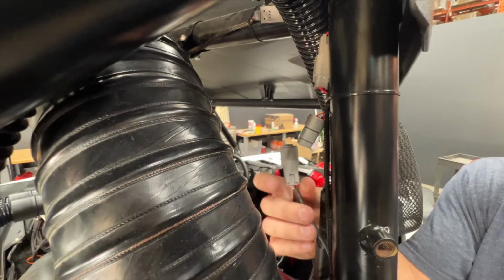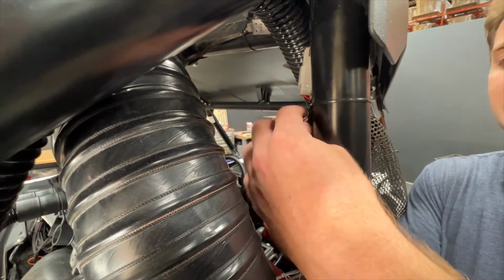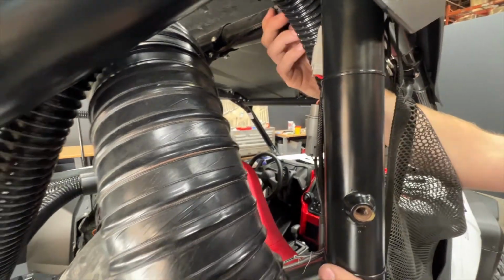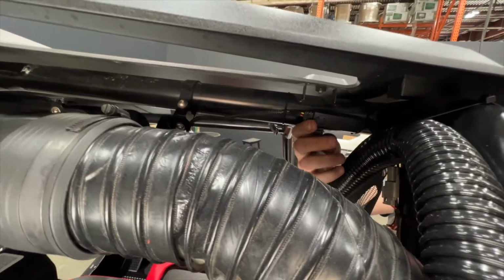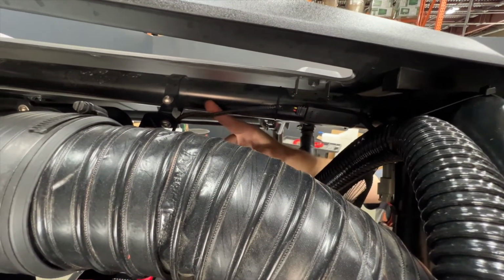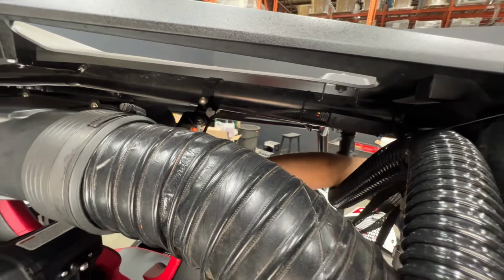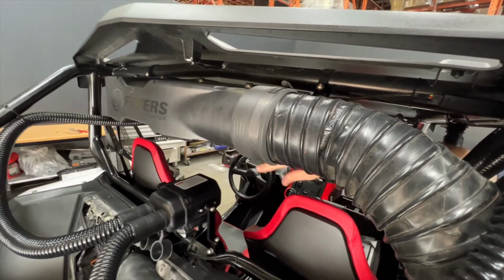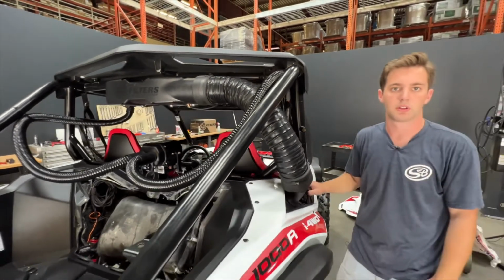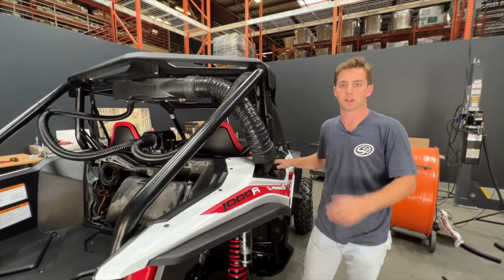With that ignition sensor run all the way out, we're going to go ahead and connect it to our main control board as well. We've got the main control board, if we look from the rear of the vehicle here, zip tied right up to the cage. With those 2 connections on one side of it, the outbound side of that is going to go straight to your engine particle separator. So you can go ahead and get all your wires tidied up now, and we'll move up to the front and start putting the hood of the vehicle on.